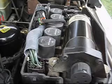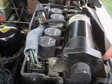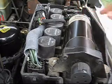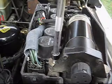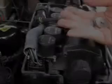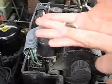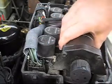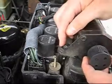Well, here's the EAS compressor with the cover removed, and the shock mounts are here. There's one here, there's one at the very back, right behind the compressor. And we're going to go ahead and remove these. We're going to use this 8mm socket, and you just simply undo them and we'll inspect them. Well, I've gone ahead and used that 8mm socket and removed the 3 washers and 3 bolts. And now we'll go ahead and pull the pump out and inspect the shock mounts.